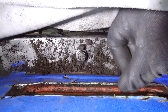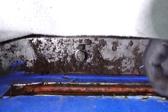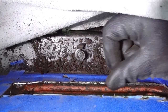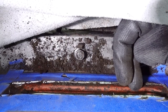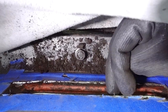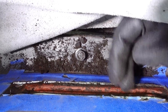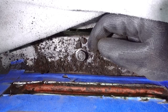What I'm going to do here is just show you guys the metal under here is quite solid still — there's no problems here, we're not covering up or hiding a problem. So I'm going to get in here now. This red stuff that you can see is the primer that was on the back of all of these panels when they were assembled. I'm going to clean all this out with a wire brush and then we'll see the quality of the sheet metal underneath. Like I said, it feels very solid, but before we put this back together, I just want to make a hundred percent sure. If I do have to cut more of this out, I will, but I'd obviously like to minimize the amount of new sheet metal I have to weld in. So let's get the brush on it and see where we're at.